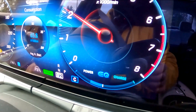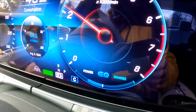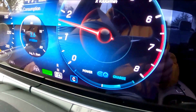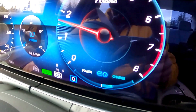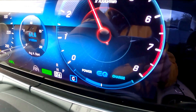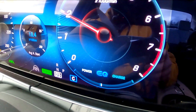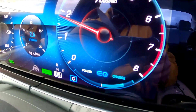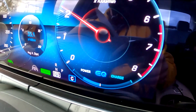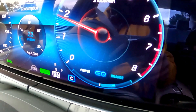In a mild hybrid like this, the electric system can't drive the car directly — if you're accelerating, the gasoline engine is running. So with this setup, it's more about giving you stronger acceleration without using additional fuel, and also completely smoothing out the power delivery, since the electric motor boosts the engine hardest at very low revs, which is exactly where turbocharged gasoline engines like this one tend to be the least responsive.